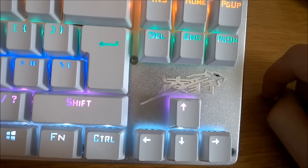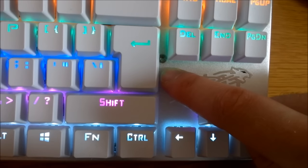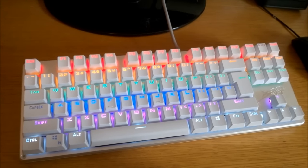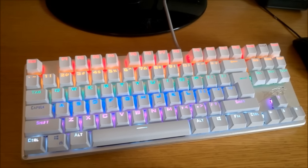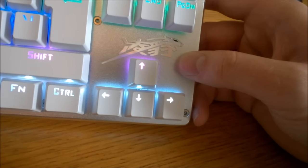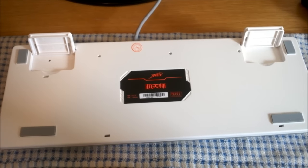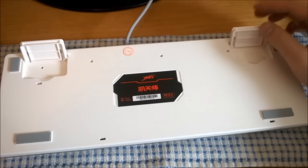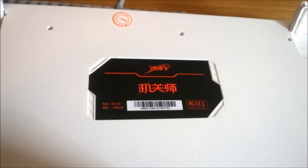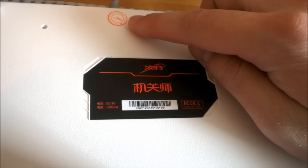It is a particularly open construction. It has a metal top plate — not the thickest or heaviest, but it adds some structural integrity. It's fastened together pretty well with screws, but they're hex screws so you'll need an Allen key for them. The top plate is not a mounting plate, but I'll get back to that when I show the actual switches. The bottom case is rather thin and hollow, with two fairly big flip-out feet which work well enough. The model sticker is completely in Chinese, but there is a manufacturing date sticker showing it was made in April this year.